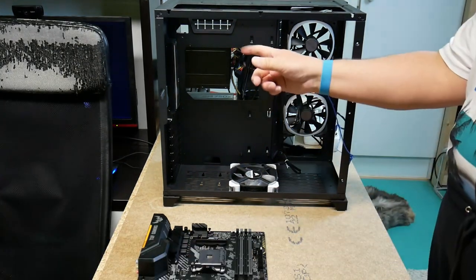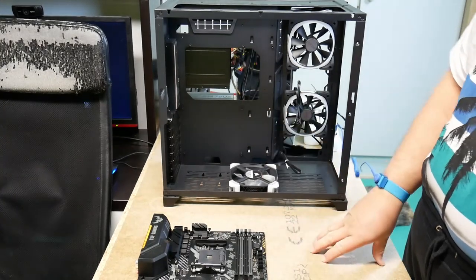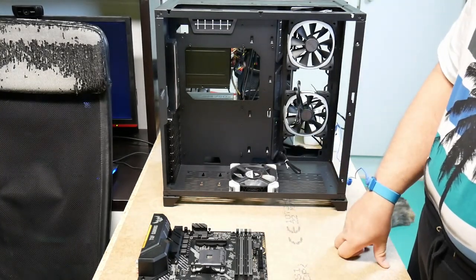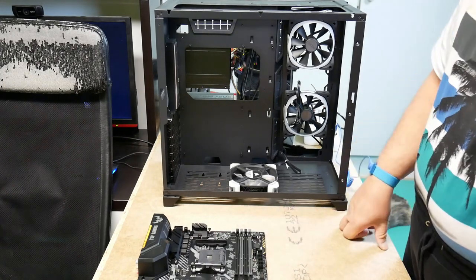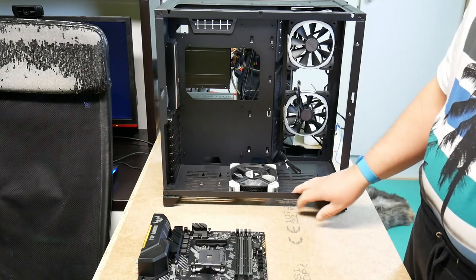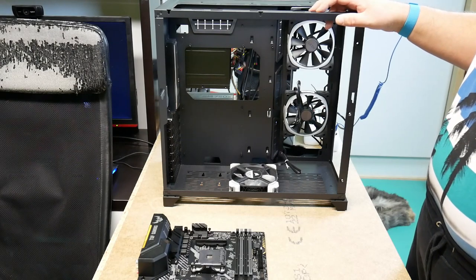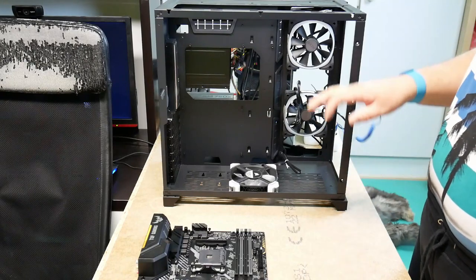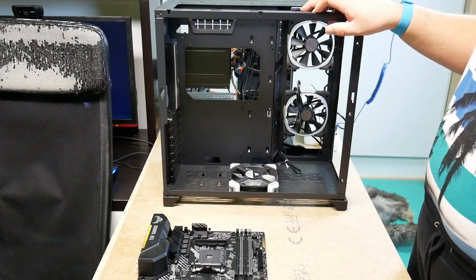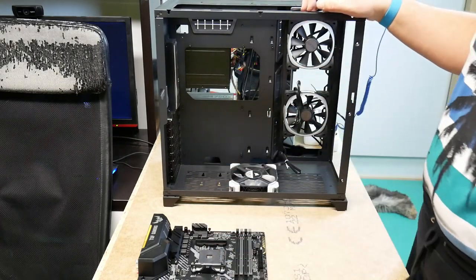So okay, that's that. We put the back plate in, and we checked the situation with the standoffs; you might need to add or remove some, depending on what specific motherboard you have. We pre-inserted it as empty, so we know it can be easier to work on this if you turn it flat on the table. So we might do that when we've populated the motherboard, lying down, and I could just insert the motherboard from the top.